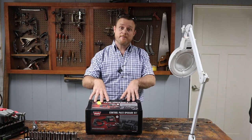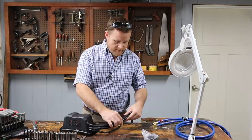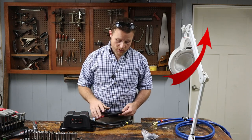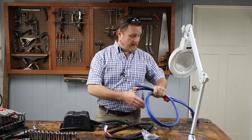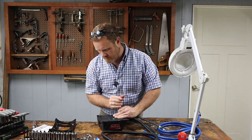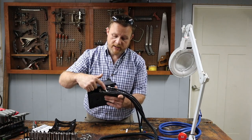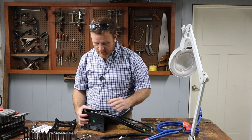I'm in the wood shop right now, so let's open up the box and I'll show you why I'm in here instead of out at the winch. This controller comes with the three wires that hook to the winch, the ground wire, as well as a factory-provided power cable to go to your battery. I'm planning on using jumper cables instead of the provided battery cable — the jumper cables I'm using specifically have a disconnect built into them, so I need to wire this permanently into the winch. I'll open up the control box, disconnect the battery cable attachment, and attach my positive for the jumper cables. The power line comes in right here to this bolt, so I'll take that off and hopefully fit the new one on — I might have to trim it down just a little bit.